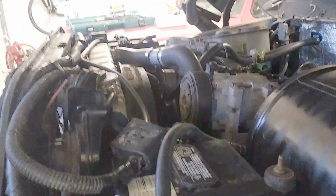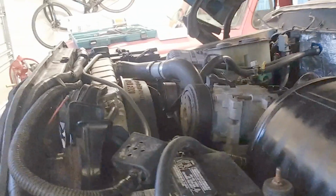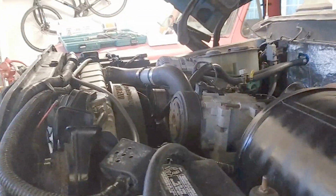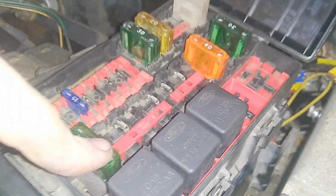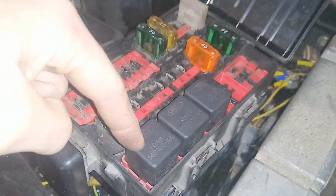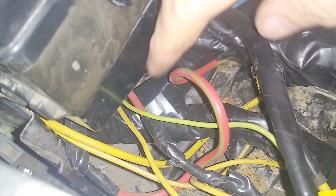On the driver's side fender lies the most critical parts of the Powerstroke wiring harness. There are some key components that you'll need to keep in order to run the engine. Starting with the fuse box, you need to keep the diode, fuses 8, 9, 22, and the PCM and IDM relays. The rest of the fuses and relays are not needed to run the engine.